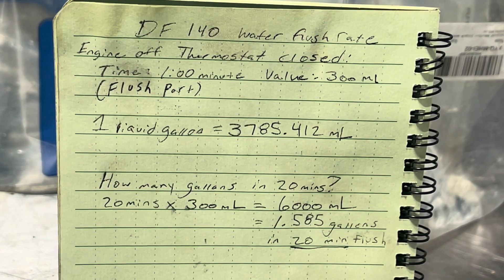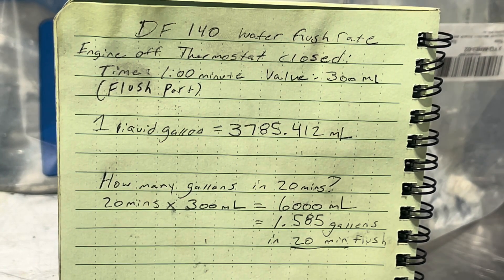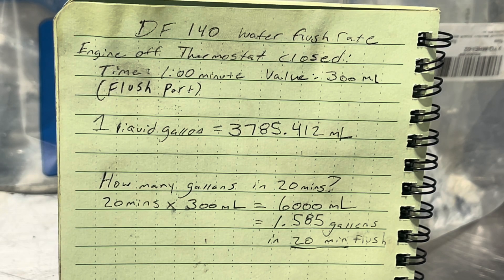If you have the ability to flush your engine on the muffs, I'm now recommending that every person does that. I know some boats stay in the water and access is hard, and the flush port does get some water through there — it's just not very much. On my motors I'm going to be using engine ear muffs, like we've all done for 58 to 60 years. I just thought this was a cool little test to conduct, and I hope it can help y'all make your decision and keep your motor alive for quite a long time. Thank you.